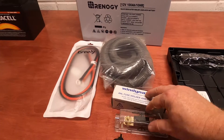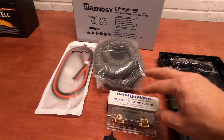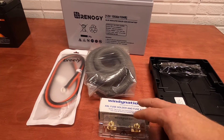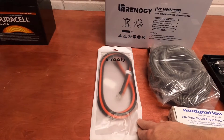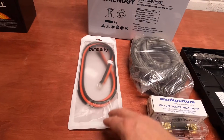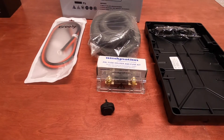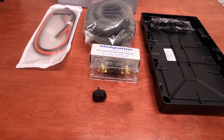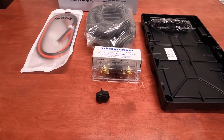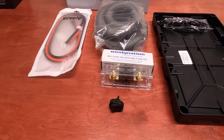This comes with two fuses in it. Because of all the supply chain disruptions here in 2020, I went to seven different stores and none of them had these type of fuse holders or fuses, so I wound up having to order online. I got a couple of new supply wires and ground wires — it was actually cheaper buying spools of wire, connectors, and shrink wrap. I'm also going to add this switch so that I can turn off the stereo. There's a USB port where the original cigarette lighter used to be, and it has a volt meter on it. The volt meter as well as the stereo memory always keep a draw on the battery, so this way I can turn this off if I'm going to leave the van sitting for a while.